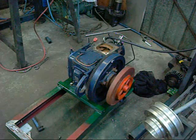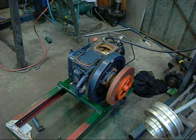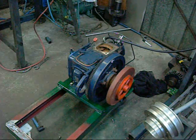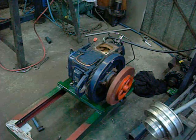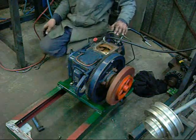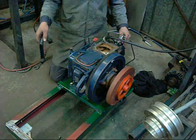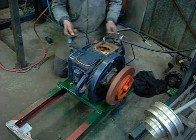I've just spent about 15 minutes cleaning all the fish and chip oil gunk out of this diesel engine. Fish and chip oil is probably cheaper than normal diesel but it's a waste of time when it comes to cleaning and getting it started. So this is just a quick test fire using normal diesel. I've had the injection line off and the injector out - it's primed and cleaned. And I guarantee this thing will start first time because I'm not running crappy cooking oil.